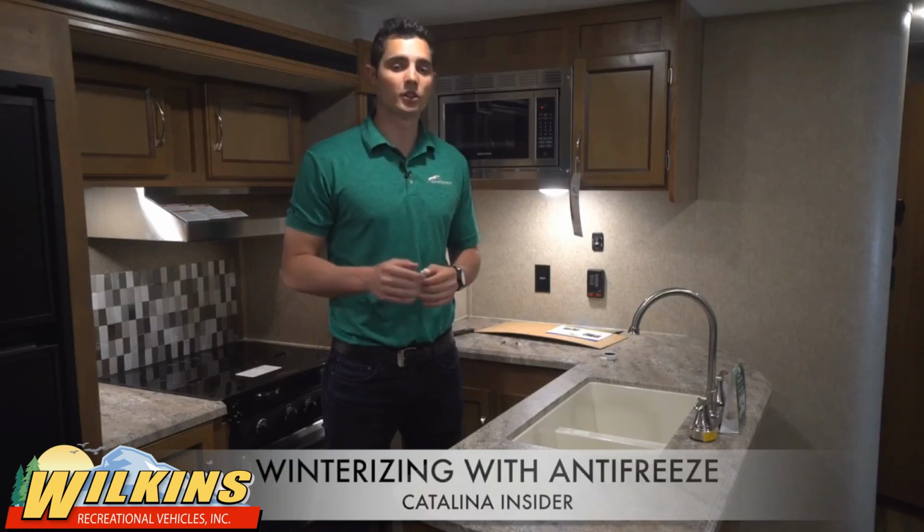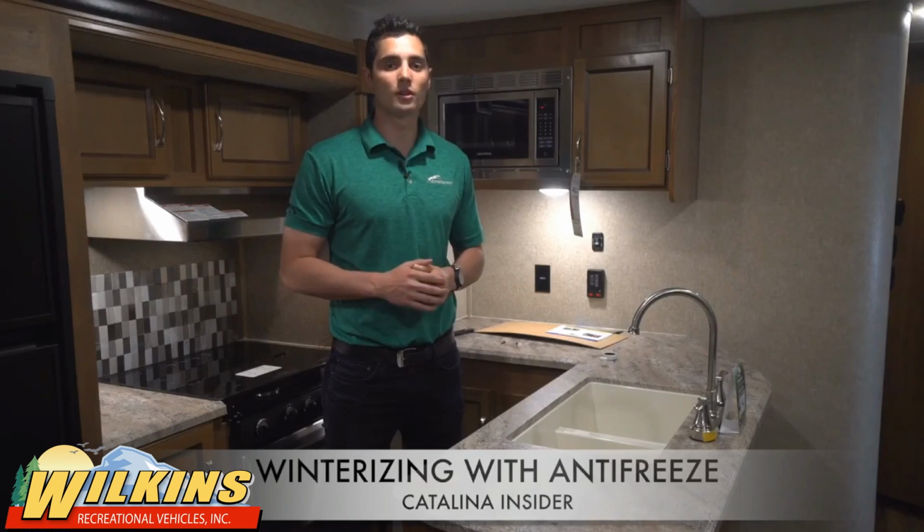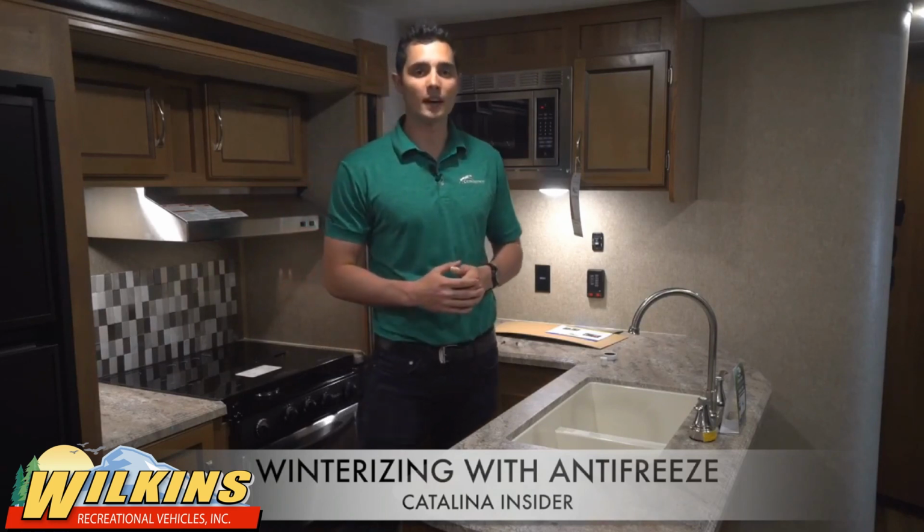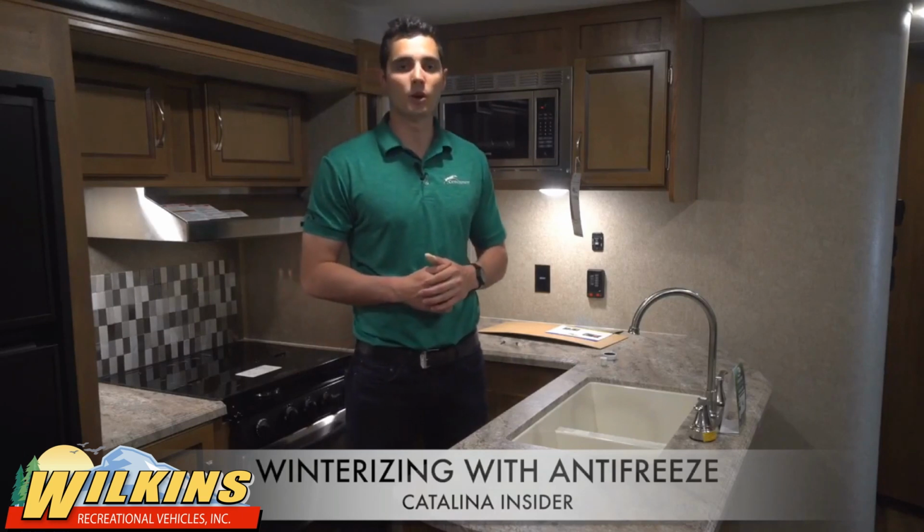Today we're going to discuss and demonstrate how to winterize your Coachman Catalina using antifreeze. Before we start, it is vitally important that you never use automotive antifreeze in your freshwater system. Automotive antifreeze is toxic and not for use in potable or drinkable water systems.